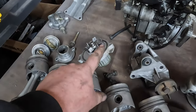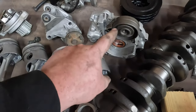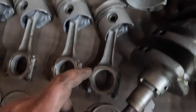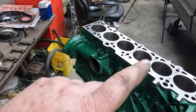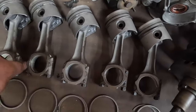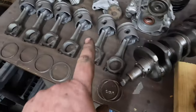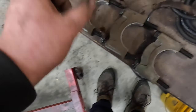The water pump is a bespoke D24 part and is going to be hard to find. The idler is an easy one, as is the fan pulley bearing. Rods and pistons are straight out of a 1.6. Although if you watched my earlier video, you know that this block is overbored a little bit, so not quite sure where these came from, but they have the right number stamped on top, so I'm going to put those in. Rings and bearings are straight out of the 1.6, so they're easy enough to get.